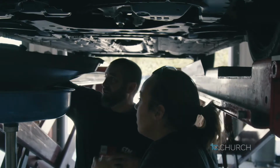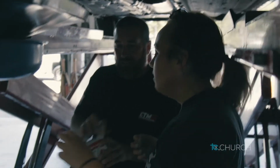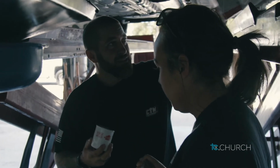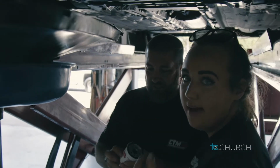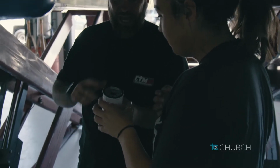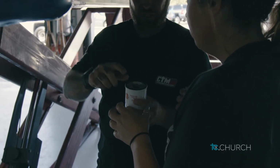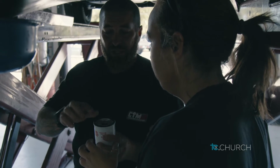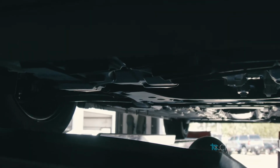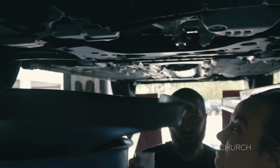So the trick with the new oil filter is you want to make sure you have the right oil filter, which we've already done. Great. As in Matt, not we. There's always a little gasket here, but you don't want to put that gasket dry onto the car. So you need to put a little bit of oil on here. Up there where the oil filter came off, see there's a little bit of oil there? Yeah. Just dab your finger on that little bit of oil.